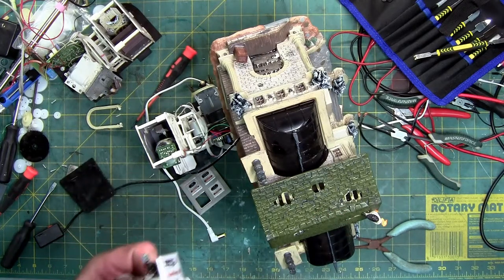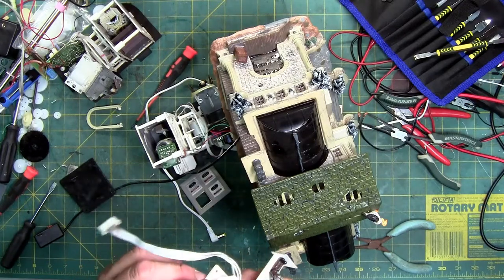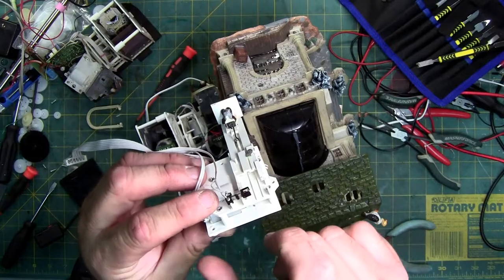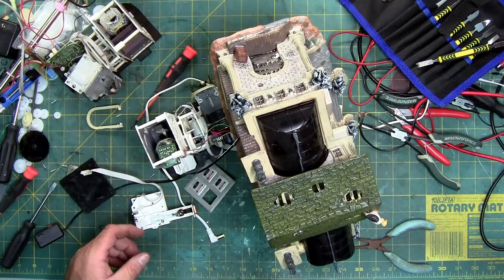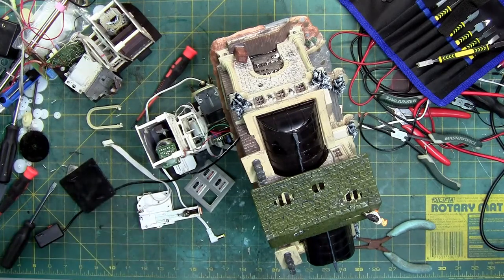So that's how you hopefully repair this. If you have a broken gear, take it apart and replace the gear. If your motor is burned out, this is a stepped-nose motor — you have to measure the barrel diameter, the step diameter, and the height. I recommend using a digital caliper in millimeters because motors are measured in millimeters. Then search Amazon, eBay, and the general internet. Sometimes American Science Surplus has them. The Parma 56 is notorious for using that style motor, and if you don't use that exact style, it doesn't fit securely and the motor can spin inside its housing.